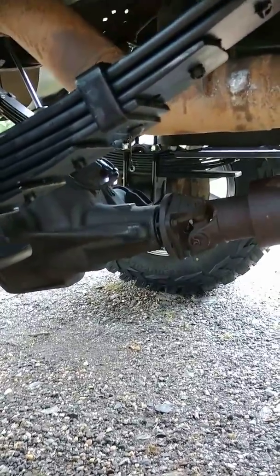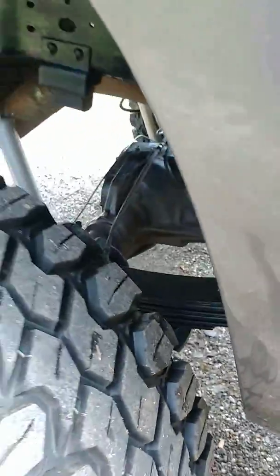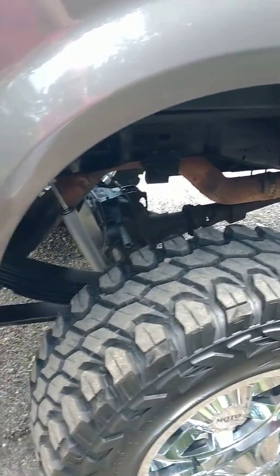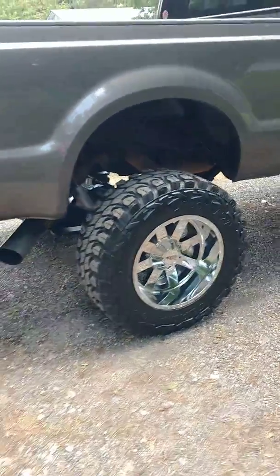Here's where we're at. This truck's got 200,000 miles on it and it's got the factory U-joints in it. Those U-joints are used to running in the exact same position for 200,000 miles. Now I've changed the pinion angle on them and I'm getting some vibration when I first accelerate. So probably what it is, I need to replace the U-joints — I'm going to do that first because that's the cheapest, quickest fix. If that does not work, I'm going to put some shims in this truck. I'm going to put an inclinometer on the yoke, take a measurement there and at the carrier bearing, and see how much we need to shim up under this spring to change the angle of the pinion a little bit and see if it fixes it.